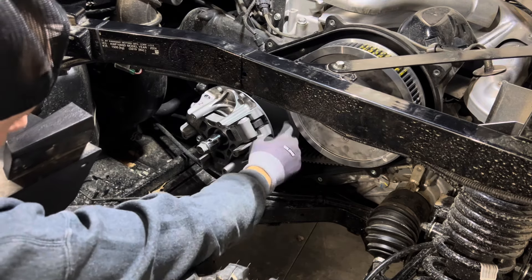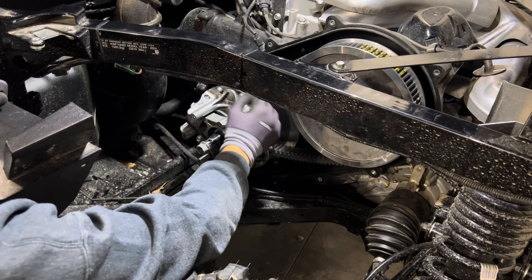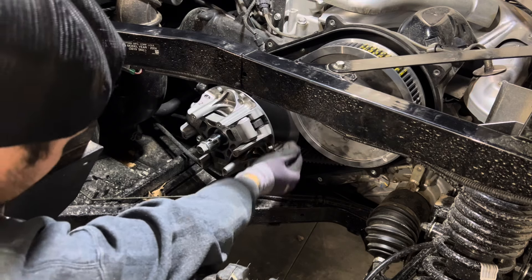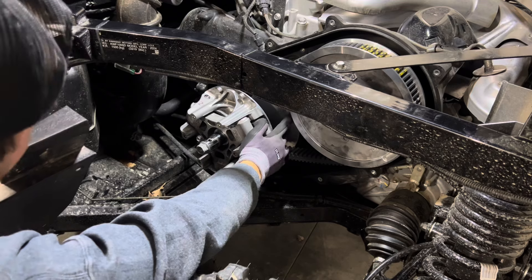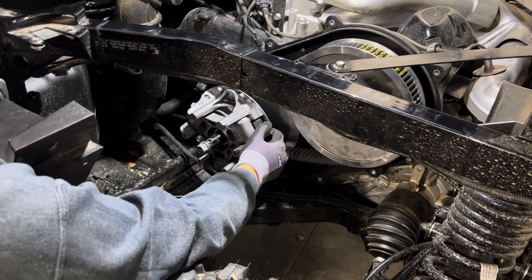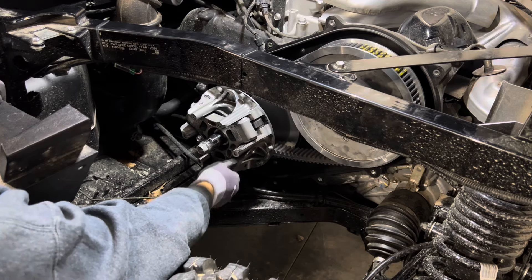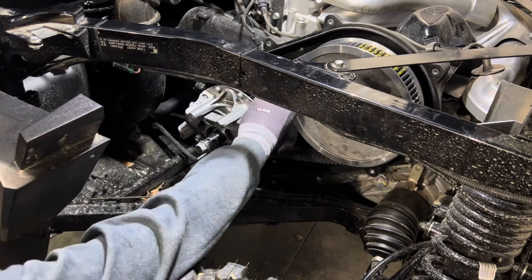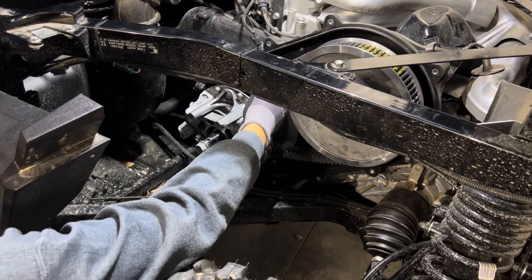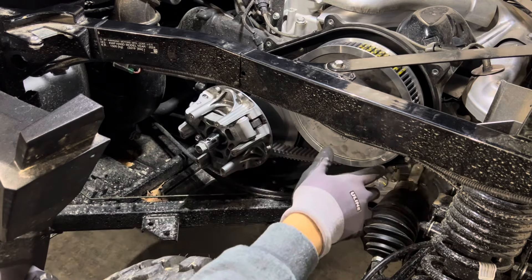The factory has a good belt haze on it, but even with stock tires our clutch kit really cleans that up. You'll see a little bit still but it's just a different color gray — not really much belt haze at all, and this one's been ridden pretty hard with 33 inch tires. You do want to check your belt for any cracks on the sides or any glazing where it looks extremely shiny.